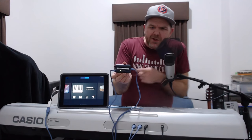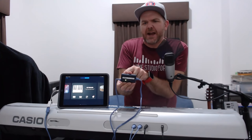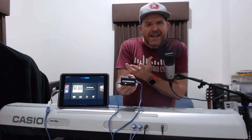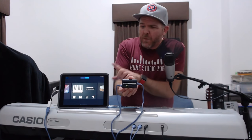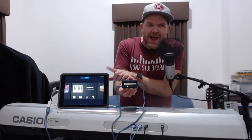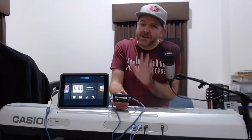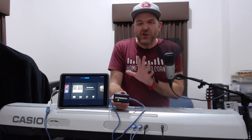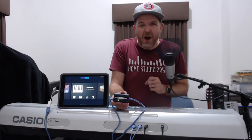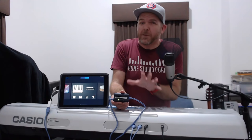That's now plugged in at both ends, and you can see on our adapter that the USB light has come on, which indicates USB connection. The MIDI in and MIDI out lights will light up when we actually play and when there's data being sent from our keyboard into our device. For many keyboards, this is literally it — you'll now be able to see this device in your Mac or PC, and on the iPad we'll be able to start using this to input MIDI into GarageBand. But if you don't see this USB light come on, it's probably because your keyboard needs to be set into MIDI mode.